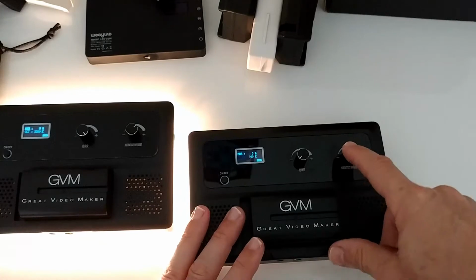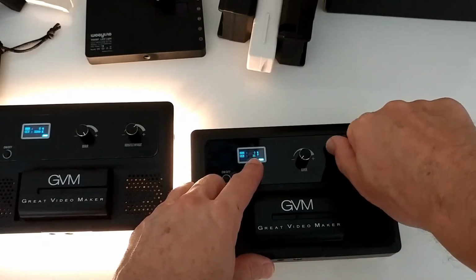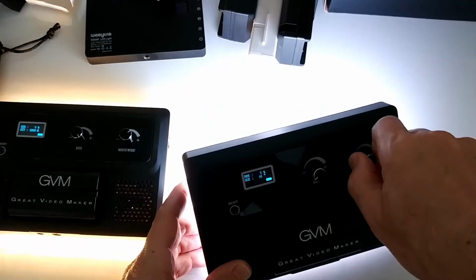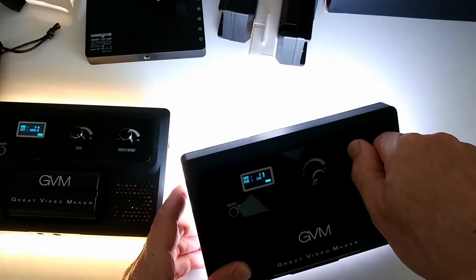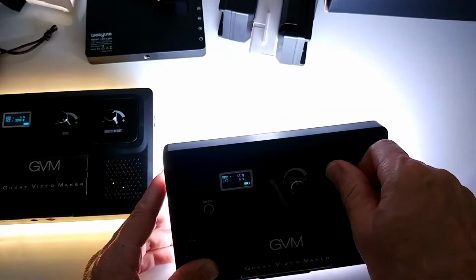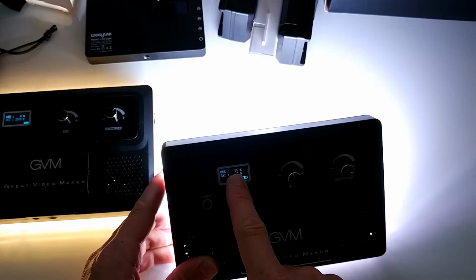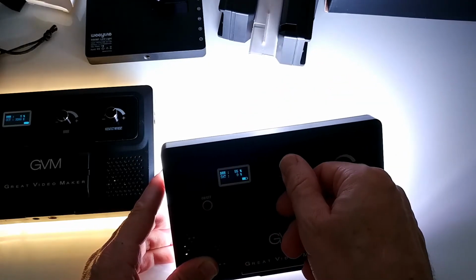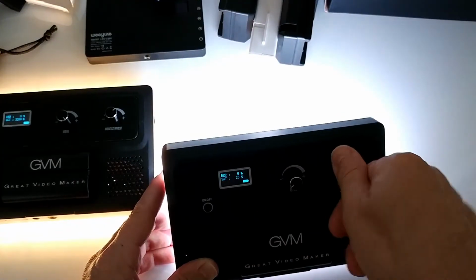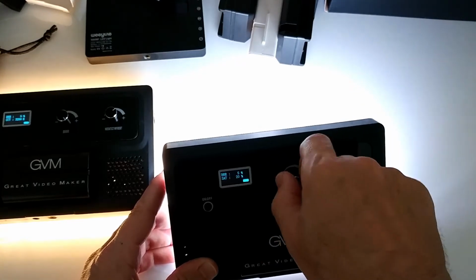So when I push here, I can change the color totally. I have to turn it on, of course. We can make it blue and red, and usually, I don't know why it's not happening now. Okay, that's strange. It looks like you have to be on a higher light volume. When you are down at 5% or so, you can't change anything, not the saturation, not the color, nothing. You have to go higher.